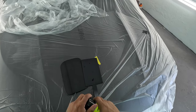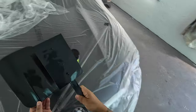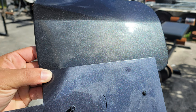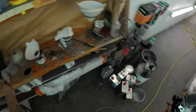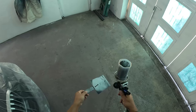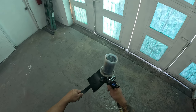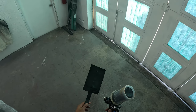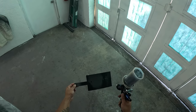A little handheld flashlight only gives you so much — you need to take it out in the actual sun and match it. Night and day — that'll never fly. Ray Charles wouldn't take that one. So I went back in the lab — there was actually another variant to this paint code. I didn't have to do a whole lot of tinting. I went and mixed another three ounces of this particular variant, which was less blue and a little darker, and it actually matched up pretty good. That's what I ended up going with.